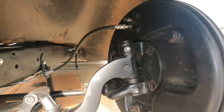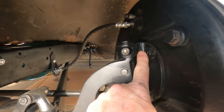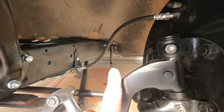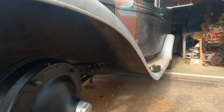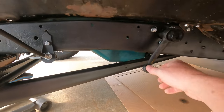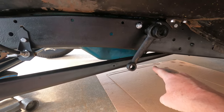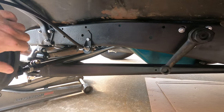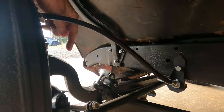Okay, here's what we got. I never got a hoop put on there, so I'm gonna have to add the hoop here on the top bolts of the backing plate to go around that, so I can steer up to that pitman arm right there hanging down. So we've got to make a drag link for that. We'll have to adjust that pitman arm, get it to center, hang it down straight, and then we'll make a steering link that'll connect up to this hoop.